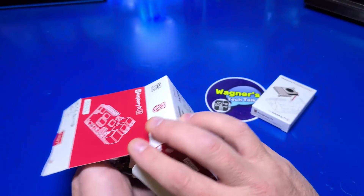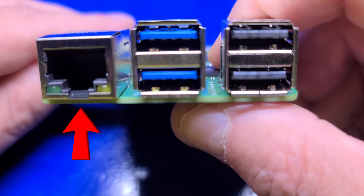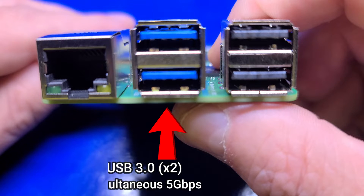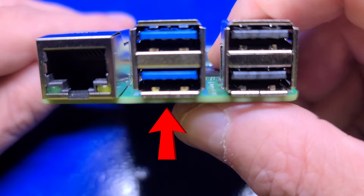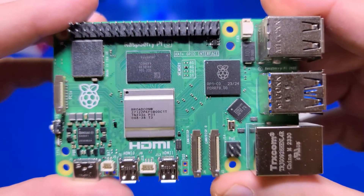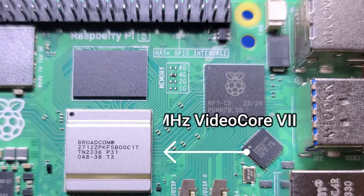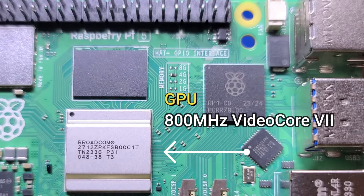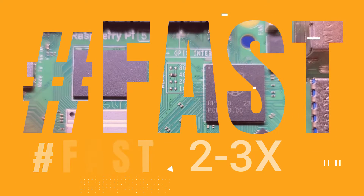Now we'll discuss some of the main features of the Raspberry Pi 5. The Pi 5 has maintained its small credit card-sized form factor. It still has gigabit Ethernet, and the port has been moved to the left when compared to the Pi 4. It also has two USB 3.0 ports in the middle, which each support simultaneous 5Gbps operations — basically meaning it can transfer more stuff faster and at the same time. On the far right are two USB 2.0 ports, which are ideal for connecting a keyboard and/or a mouse. In terms of processing power, the CPU is a Broadcom BCM2712 64-bit ARM Cortex-A76 quad-core chip operating at 2.4GHz. It also includes an integrated 800MHz VideoCore 7 GPU for improved graphics processing. In a nutshell, the brain of the device is two to three times faster than the prior Pi 4.